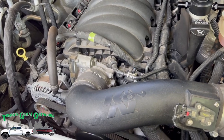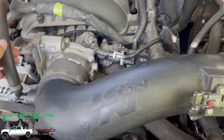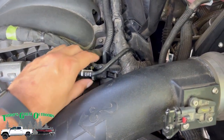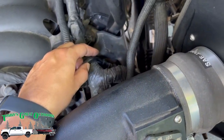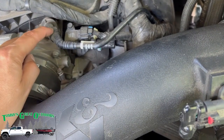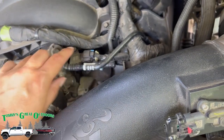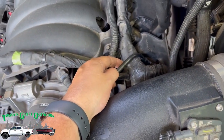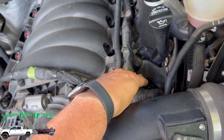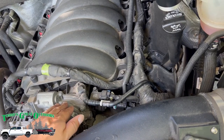All right, on to the hose install. Now don't get them confused. Leave this one put. We're going after this PCV line that's here, just behind the throttle body, and it looks like it connects down to the manifold down there, and it's just a little gray tab here that you push in and disconnect. And basically it's recycling air along with some oil and some junk that's getting reused from your manifold here, and it's getting dumped back in to your intake over here.